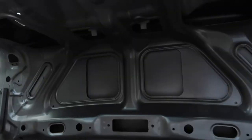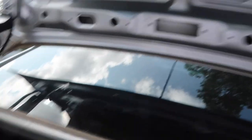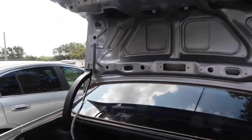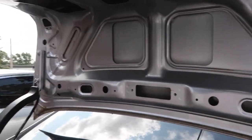So last night, what I did was I actually spent time and I started stripping down the underside of the OEM trunk because we're going to be putting the Endless RPM little duckbill trunk on. I'm going to show you that. And there you can see the naked trunk. Kept all the nuts and bolts in this bag. The liner and the other trunk are inside the car. This is about ready to come off — all the lines are stripped. Just got to take these nuts off and the trunk's coming right off.